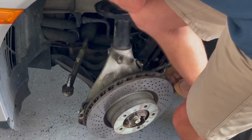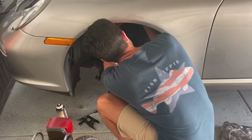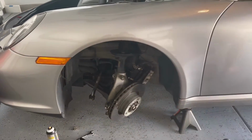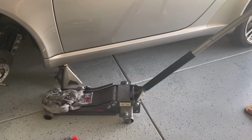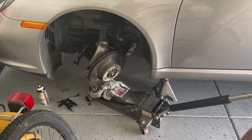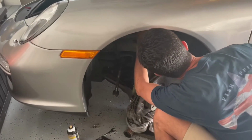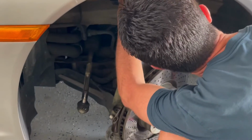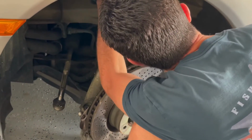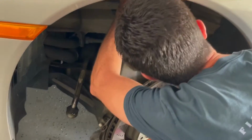In there, it's underneath the car. Now, just position it here, and you'll get it. Basically, now we're roughly aligned. Grab your jack, put it underneath the A-arm, start jacking up a little bit. You guide it into place now. So, position it like that. And this is all you do. And you have basically got this sucker back in. Real life struggles here, people.